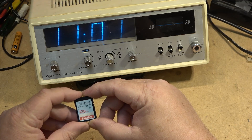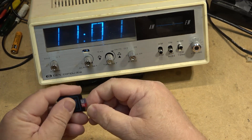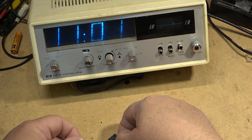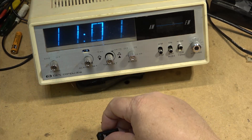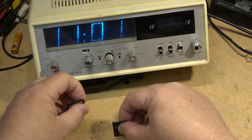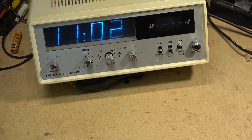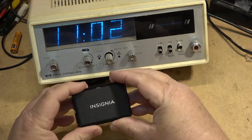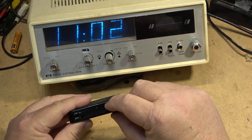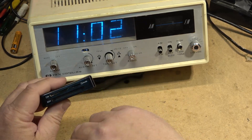So I went and put a different brand — a Lexar micro SD in an adapter. This isn't the card I'm actually using, just for illustrative purposes. This one is Class 10 / UHS-1, whereas the one I'm currently using is UHS-3, but that's not the issue. The issue is when I take the card and copy files to my computer using this Insignia USB 3 reader — it's fast and supports SD, micro SD, and compact flash.